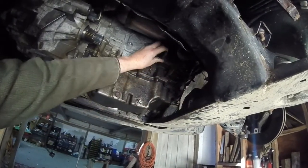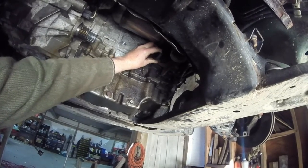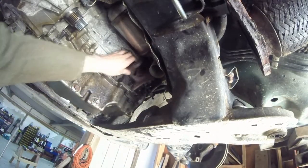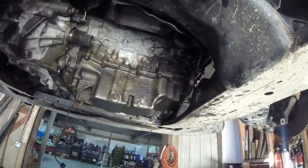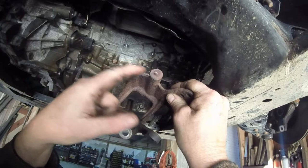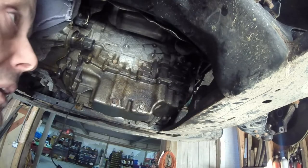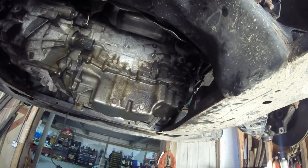The big thing is there's a plate right here that supports the front snout of the transfer case going out to the CV shaft output — that is by far the worst thing to get off. There's also a bolt right there that's terrible because of a heat shield. And there are the two bolts that hold the converter on — I've got to put a nut on those and try to weld them to get them out. I'm not too hopeful, and I'll be doing that off camera because you don't want to hear me swear.